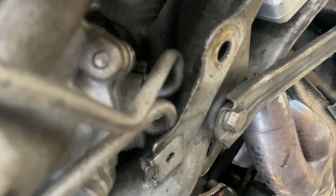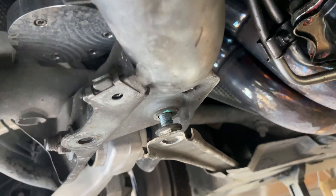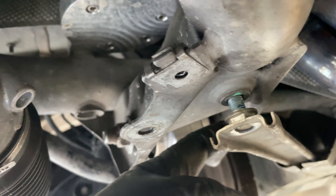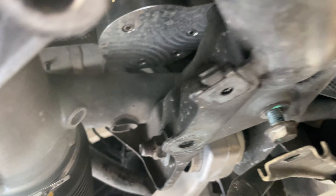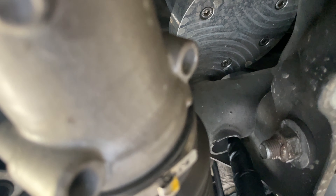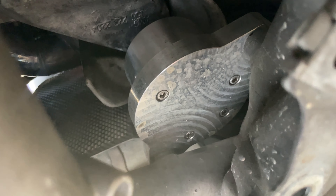Here's the power steering rack and sway bar — this is the back of the car, here is the subframe. This is going to be a 16mm bolt. There's one on this side and one on the driver's side, so we're going to start by taking those off. Got those out — super easy. I can see there's maybe some blue Loctite on there, but it didn't give me any problems. To help keep track of where bolts go, I just re-threaded each one back in without the bar on it, and did the same on the other side.